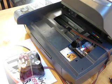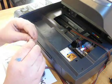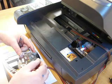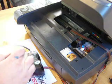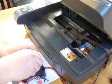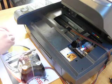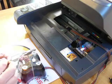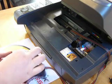One of the next things we need to do is install the air filters. Within your accessory pack you will see some small air filters — they have a narrow pointed end and a short fat stubby end. These are your refill holes; when you need to refill the system you take the plug out and can either use the provided syringe to top it up manually or just pour the ink in. These inner four plugs are the air balance chamber and that's where the air filters go. Remove the four small flat plugs from the system and install the air filters fat end down — the small stubby end has to be inserted down. These control the amount of air that gets into the system and help push the ink down the line.